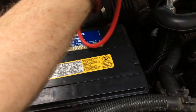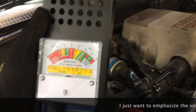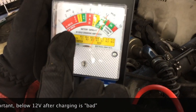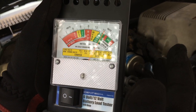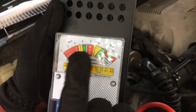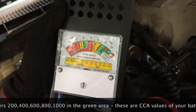I haven't used this particular tool before, but I've used something similar. You put it on like jumper cables — negative and positive — and when you first connect it, it acts as a voltmeter. There's a scale on top for 6-volt batteries and one along the bottom for 12-volt batteries, so it's showing us 12 volts. There's a momentary switch — per the user manual, you hold it down for five seconds only, and that's enough of a load test. We watch to see if the needle drifts back into the bad or weak area. Here we go: one, two, three, four, five.